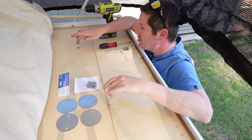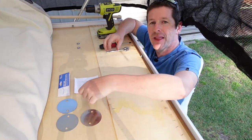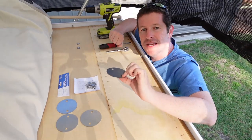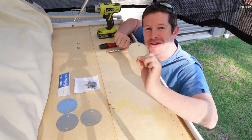What we'll do now is drill out these two rivets from the top side, remove the brackets from underneath, and then install these discs on the underside of the floor using the bolts inserted from the top, and the nylock nuts and washers from underneath. It's literally a 10 minute job and you'll be done.